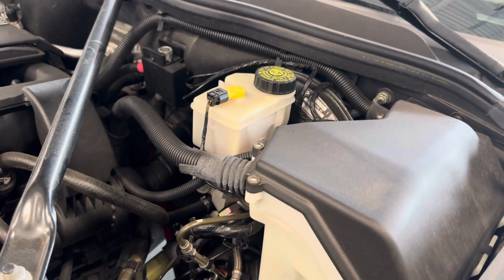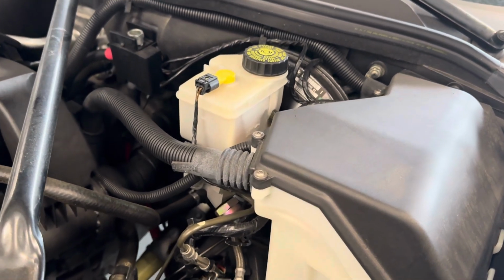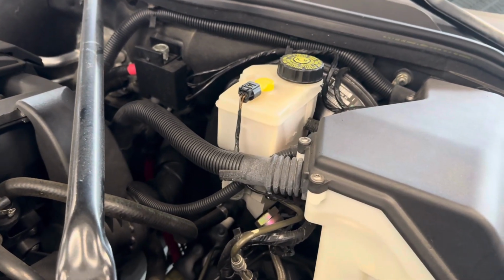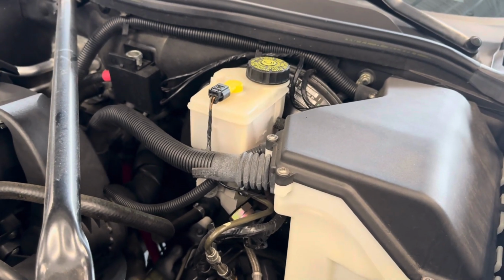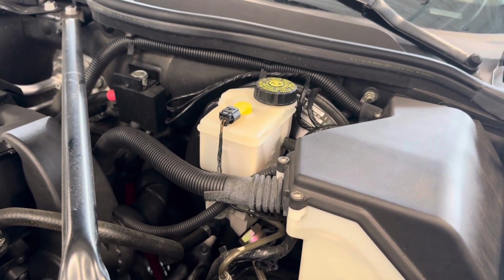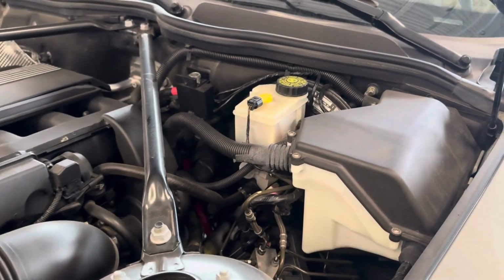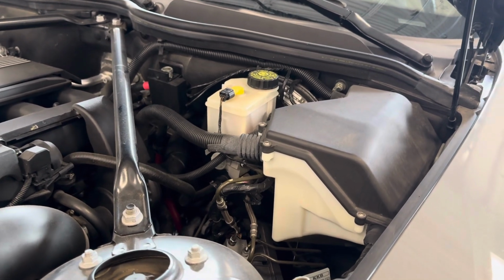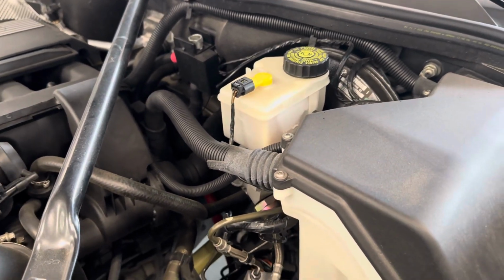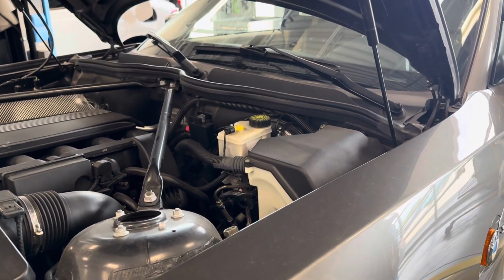And just one more tip before we wrap up the brake fluid flush completely: if any brake fluid spills anywhere at all, a good combatant to brake fluid is water and soapy water. Soapy water is more preferable, but normal water will work if that is all you can get to in a timely, quick manner. Just pour it on where that brake fluid leaked and everything that it touched, and that will help neutralize the corrosiveness of brake fluid, and help to prevent any damage it can do if it were to get on bodywork, tires, wheels, brakes, and anything else it could come in contact with.